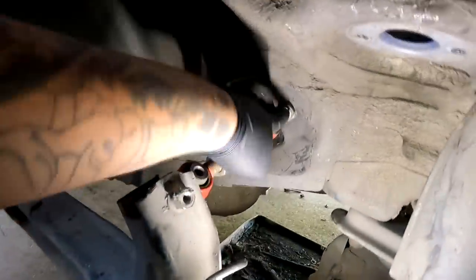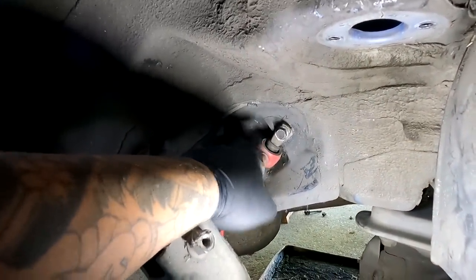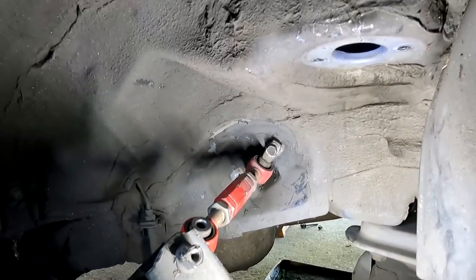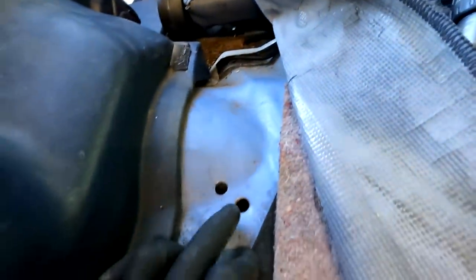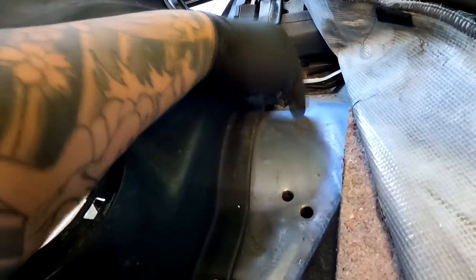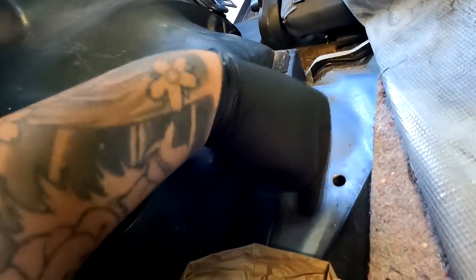Back in the garage, guys. I already took off the rear suspension from the wagon. I'm struggling with the camber bolt on the opposite side that my brother told me about — this one is just spinning in a circle, and the nut on the back side broke off the spot weld. That's why it's not coming out. I went and drilled out two small holes to peek through, but I can't figure out where the bolt lands. The one towards the front of the car I know from doing it on my brother's brown wagon, but the back one towards the rear I don't know where it is.